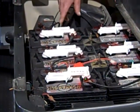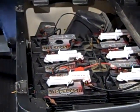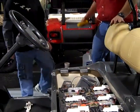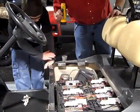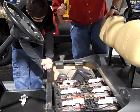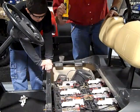First thing we want to do is take this cover off. We're going to get ourselves a flashlight. Look inside those holes. You see those plates in there? The things that look like cardboard? Exactly. Those are your plates. And what you want to do is make sure the water is about a half inch above those plates.